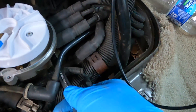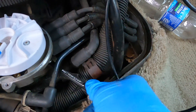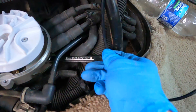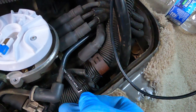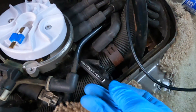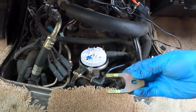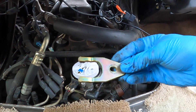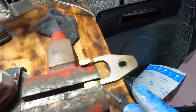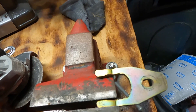To start, we're going to go ahead and remove the distributor hold down clamp. In my last video I showed you guys how to replace the distributor, and we're actually not even going to take the distributor out. What we're going to do is modify this hold down so that we can move the distributor around a little bit. We're going to use a grinder and slot this hole in one direction.